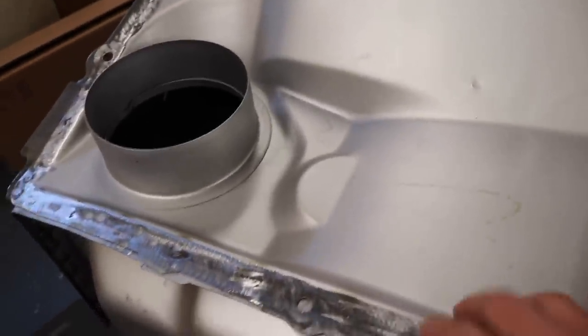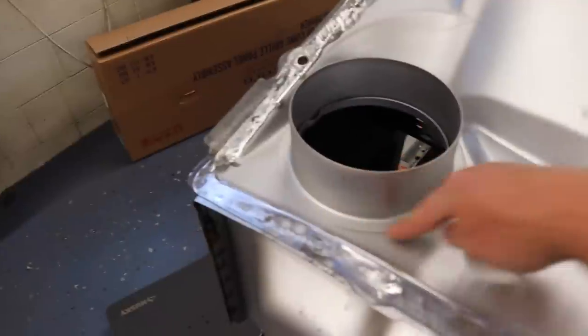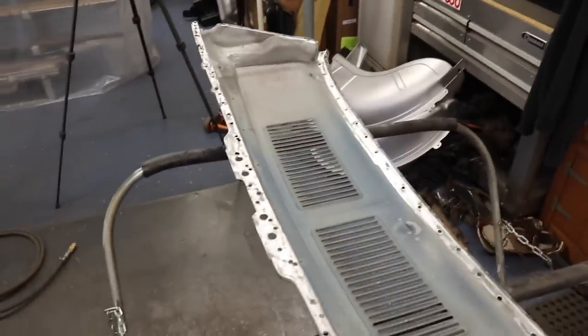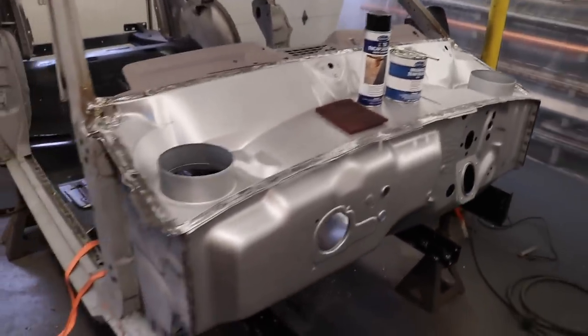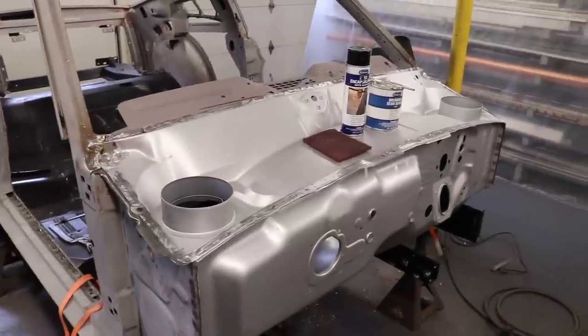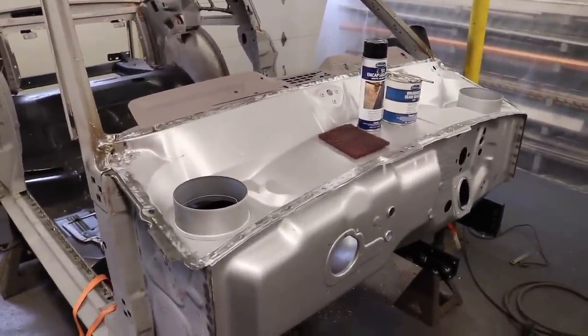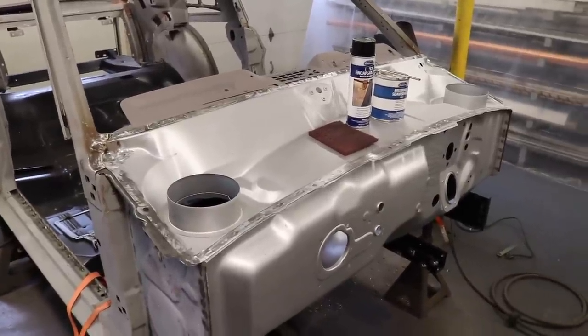So it's best I prime it, put a nice coat of seam sealer around that, and then I'll go ahead and paint it again over top of that and the bottom side of this upper cowl. I'll hit with a couple coats of paint as well before I actually meet the two together. So just to show you the process on this, I have the GoPro set up and I'll go through everything here until it's nice and coated, and then I'll be back to show you the end result before I put the cowl panels together.